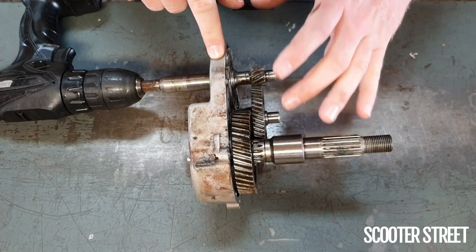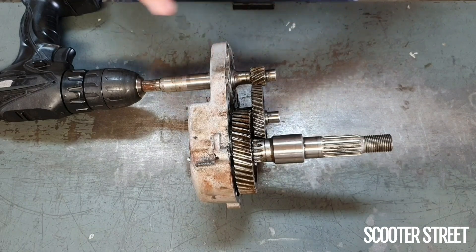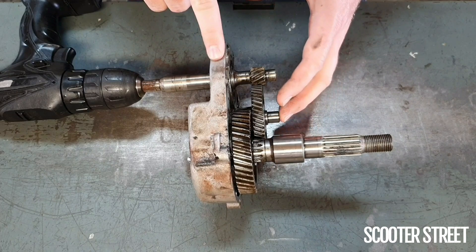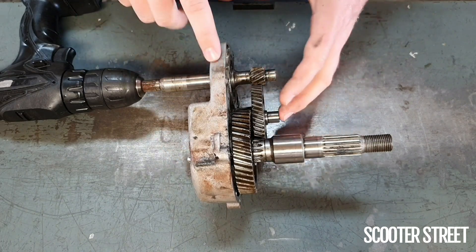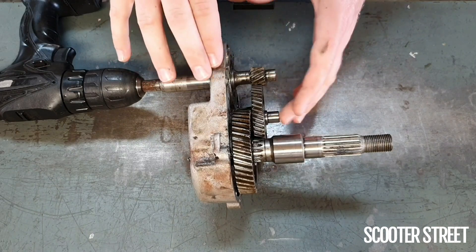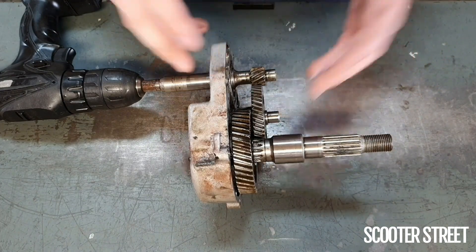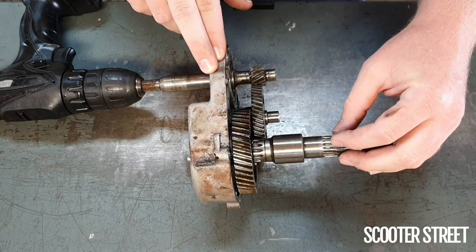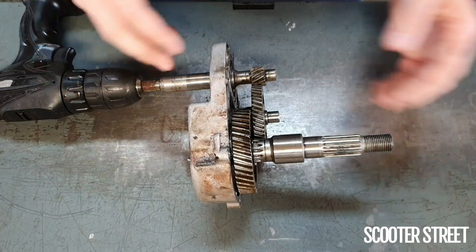The purpose of these gears is to reduce the gearing so that the engine can rev at a significantly higher speed than the wheel is turning. It works very similarly to the diff in a car, except the diff in a car is doing a couple of different things. This is essentially just reducing the gearing so that the engine can rev up at an RPM that a two-stroke engine is happy revving — say 7, 8, 9,000 RPM — and get the optimum amount of rotation on the wheel for the speeds you're going to be doing on the road.